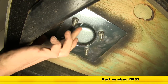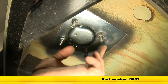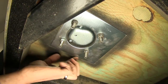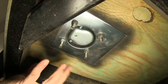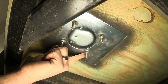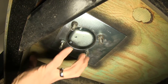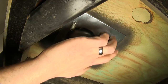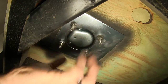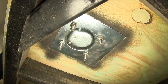As you can see, the four bolts that come through our tie down are going to run right through our backing plate, allowing us to put on a lock washer and a nut, really spreading out that holding force over a greater area. If we just had the four bolts coming through here, we'd be limited in the amount of space actually holding our tie down down. Once we have this incorporated, it's going to spread that out, dissipate that energy and give us a good, strong tie down connection point.